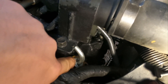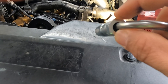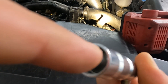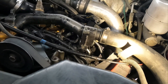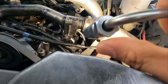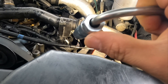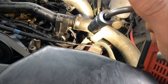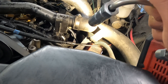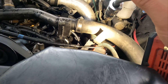One thing you want to do if you're going to change a line out is put some sealant down right in there, because that's going to keep all the dirt and debris from falling down in there. When you remove this line it'll get between the cracks and fall directly into your injector, and you have to clean that out and cross your fingers hoping it doesn't clog your injector. If you have the OG injectors or really old rusty injector lines, you can almost guarantee that removing this line is going to dump debris down into your injector.